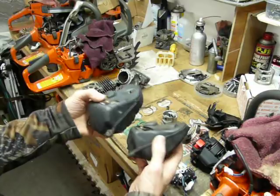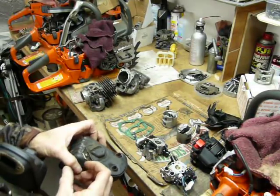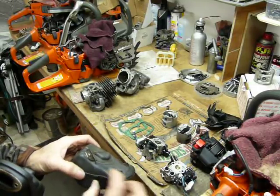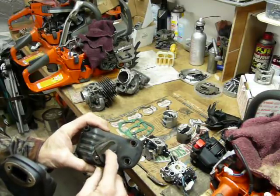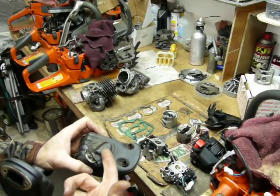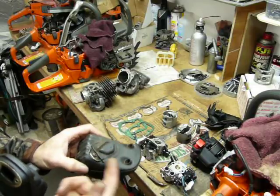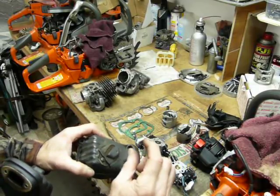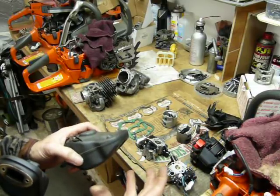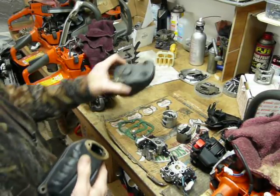Same basic concept. There's a tube that's inside. It has holes in it that lets the exhaust come out of the tubes in different locations around on the inside. And then inside the cavity, there's a little tube that's about this long that's welded in the bottom underneath. Well, it's the top, I guess, on the bottom of where this is called the exhaust outlet. Underneath the exhaust outlet, a little tube runs down in there, so the exhaust goes in, has to disperse, and then has to collect again and then come through the tube. I don't know if they're trying to get like a pipe effect.